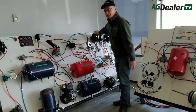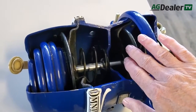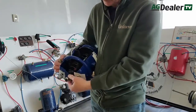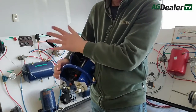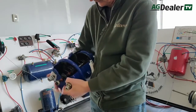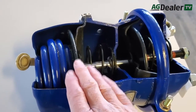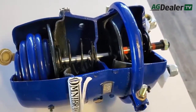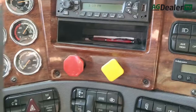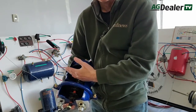What goes on in here — let me show you. This is a mock-up of a brake chamber. This lower part is the service brake chamber. Air pressure comes in, presses against this rubber diaphragm, and forces the push rod out. A proportional amount of air set by the foot valve comes in here and makes a proportional amount of pressure on the push rod. These are called piggyback chambers because on the top is a second chamber for the parking brakes. This chamber works exactly opposite to the service brake chamber. In this case, a massive spring is what pushes on the push rod to apply the brakes. When you release the parking brake by pushing in the yellow button, air fills up this chamber, compresses the spring, pulls the push rod back, and releases your brakes.